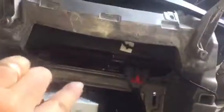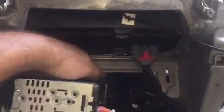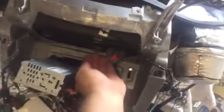Okay, so I started mounting the radio in my bike. This is the one I just made. Now, you're going to see the cable goes underneath this frame. If you can't get the cable through there, there's 4 bolts. One, there's 2. See that bolt right there? There's one on that side and one on the top. 4 bolts, and you could literally pick up this whole fairing a couple inches. Very easy to do, and you could pass the wire through there.